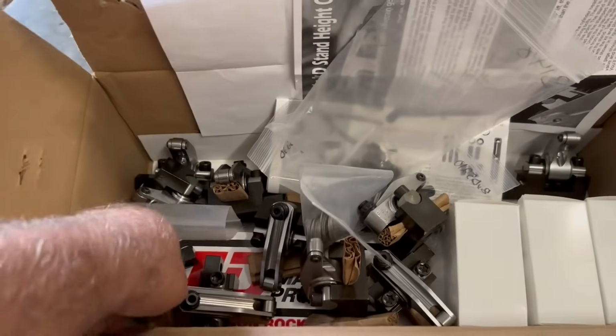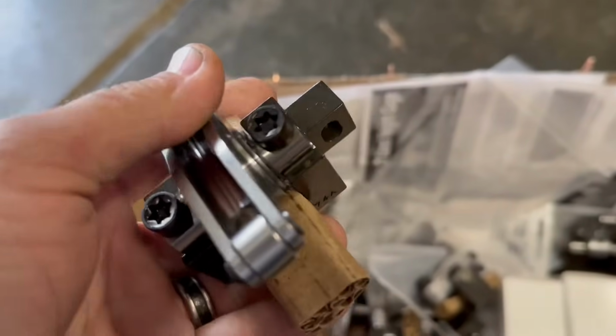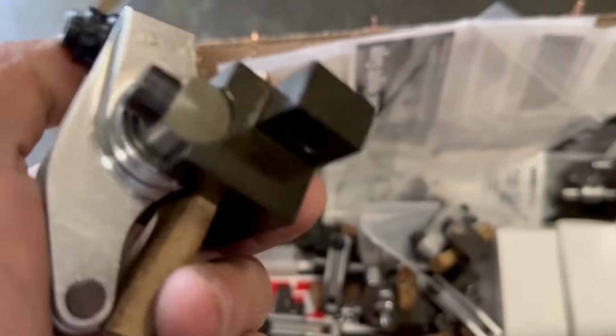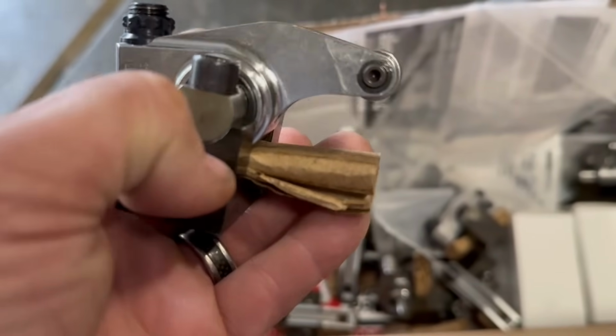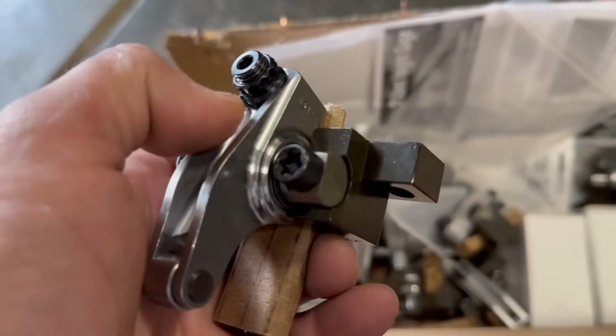They have a couple different styles of rocker arms, and these are the steel ones. They have aluminum and steel, and he was telling me that for what we're doing, the steel ones are a little heavier, but they are more long-term duty. Aluminum has a shelf life, and that's what he was saying. Aluminum rockers, any aluminum rod, any rocker, they're going to fatigue.